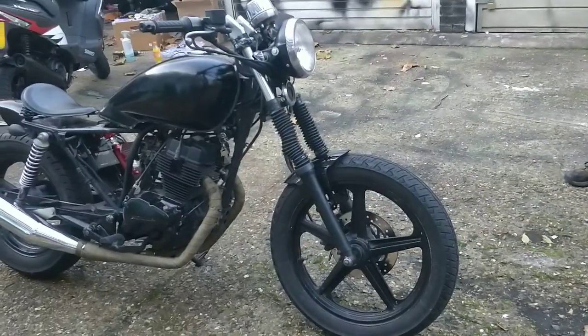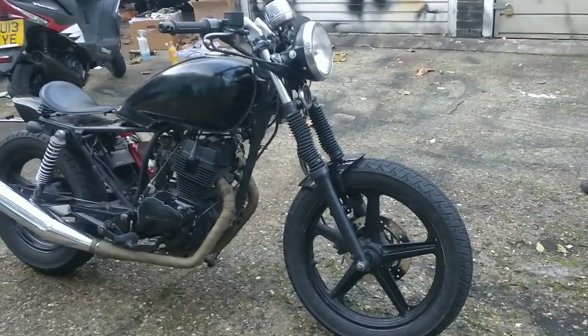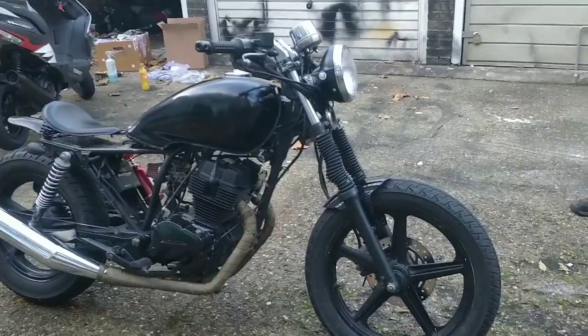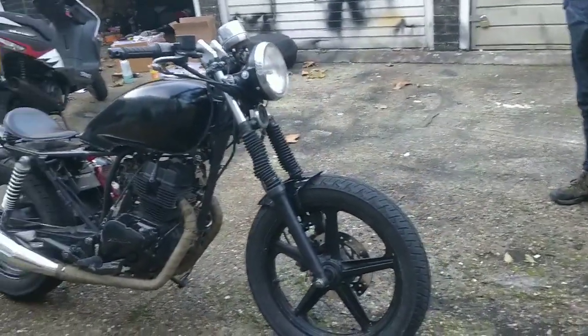At the moment, it runs and rides and pulls as strong as it should, and we can't hear the valves, which could mean they are a bit too tight. Apparently, tapping valves can be a good sign sometimes. It means they're loose, but not overly loose.